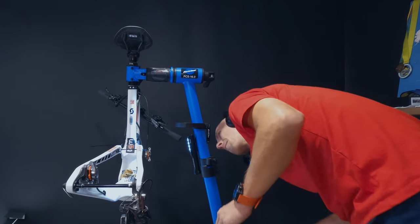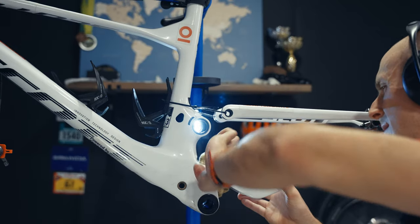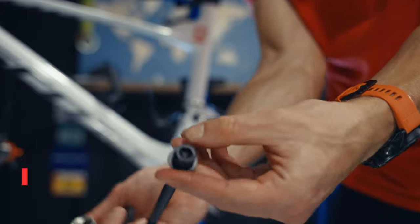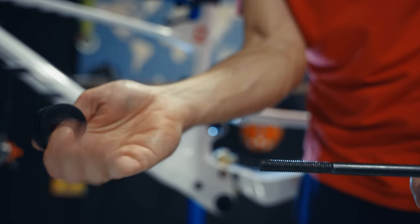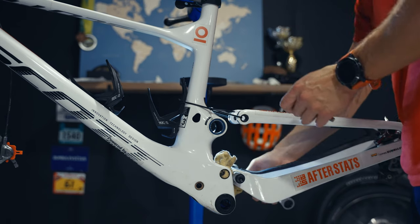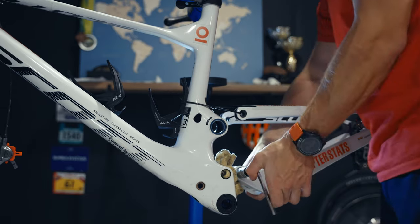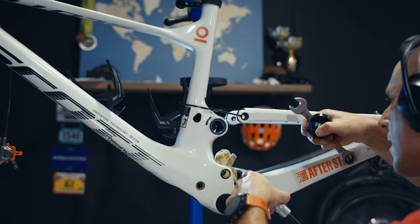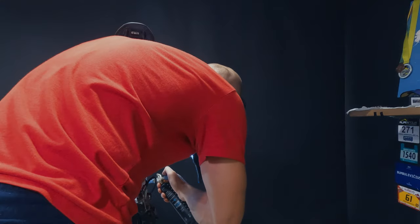It was a tough process and you could see there was some sweat on my forehead. I was stressing a bit about how to make it work, because there's a difference when you're recording everything versus just doing it without much thinking. Here I used a 17mm socket head to press down the bearing. Be aware that the size might be different for yours in terms of outer diameter, so always make sure to choose a size that fits right inside the hole — don't use anything smaller or bigger. You can see I already did one bearing replacement once before and then removed the swingarm completely.